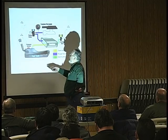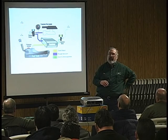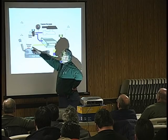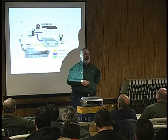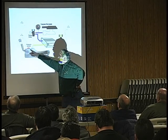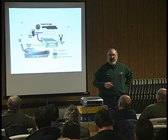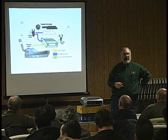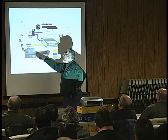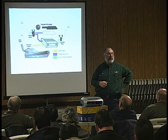This was happening a few years ago. Later on, I checked another Kia that came in with a similar problem. Kia has now addressed this problem, and now they have a rerouted vacuum line system on a TSB bulletin, so it no longer acts like a drain trap anymore. So it doesn't collect the vapors anymore. At that time, what I did, I just made up my own line without a drain trap on it, and didn't have any more problems.